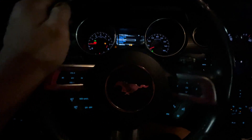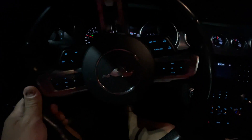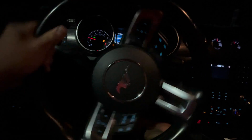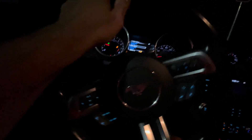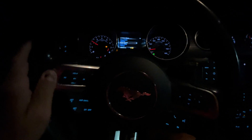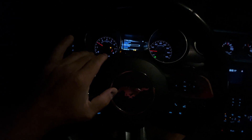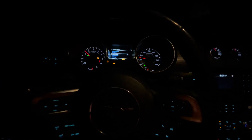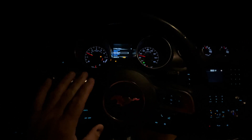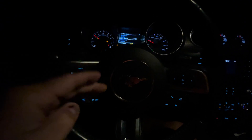We're doing it live. It's something that I think is useful for a lot of people that roll race. I'm not a roll racer myself, but I understand the usefulness of this. The other thing this is useful for is burnouts. Think about it - if you hold down the cruise control off button while you have your set point, it won't go past that RPM. Some of you that have trouble doing burnouts can literally set a burnout limiter using this limiter.